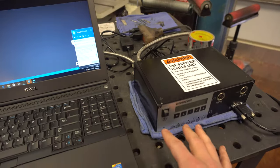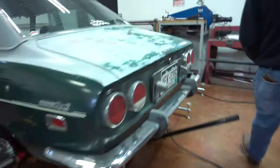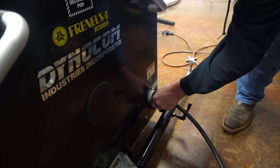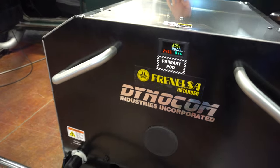We just made that. It said everything looked pretty decent, so turn this box off, plug these in, and then make sure that we have 220 at the pods, because there's a voltmeter right here that will tell us, I guess. Put this one in. I went ahead and moved the ground clamp. We ended up getting the ground clamp back to our deal. There we go. So now I will kick these on. Power at the pods. And now we got 245 volt there. That works.